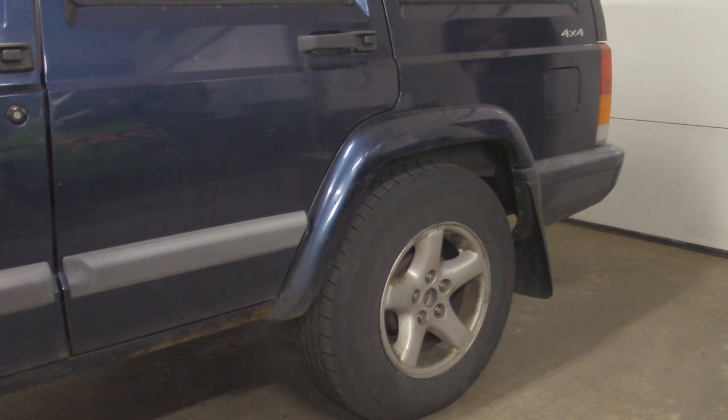We're going to be doing these add-a-leafs on this 2000 Jeep Cherokee — it's going to be similar across all Jeep Cherokee models from 84 to 01. The way we're going to be installing this add-a-leaf today is with the leaf pack still in the Jeep, and it's going to be a lot easier than having to unbolt the entire leaf spring, because that way we don't have to deal with the bolts that like to rust inside the leaf spring bushing and end up having to be cut off. What we've got to do is jack up the rear end of the vehicle with jack stands underneath the frame, pop off the wheels, lower the axle down with the jack so it's at full droop, then unbolt the axle from the leaf springs, then we can proceed to take apart the leaf packs.